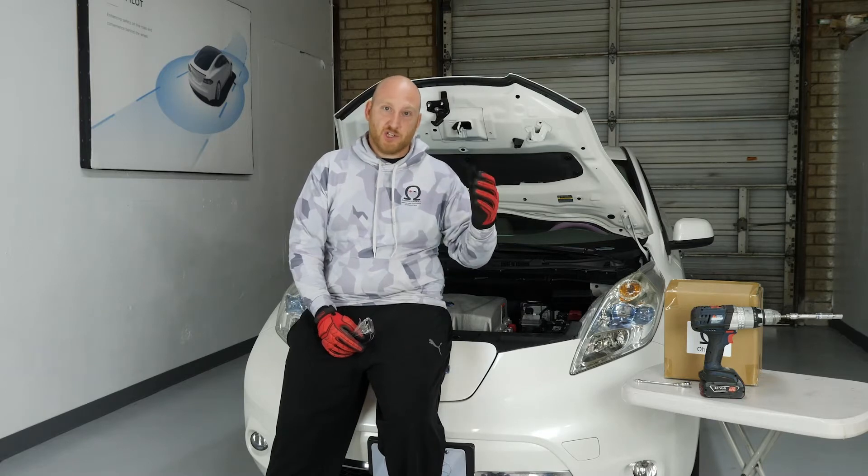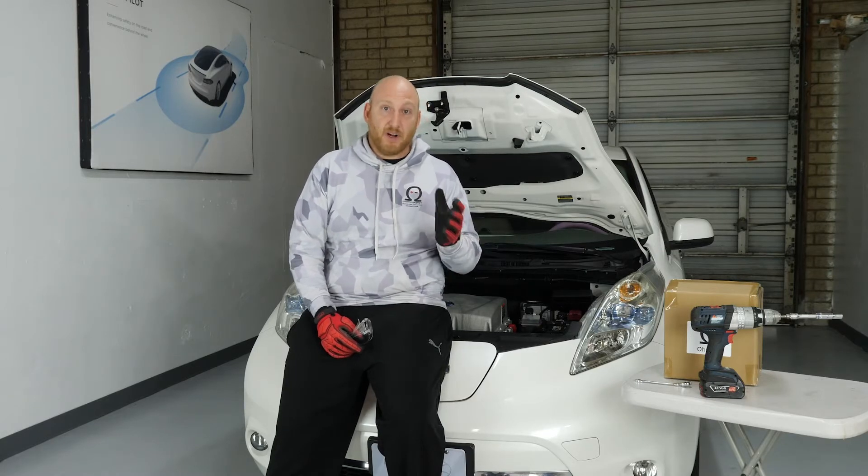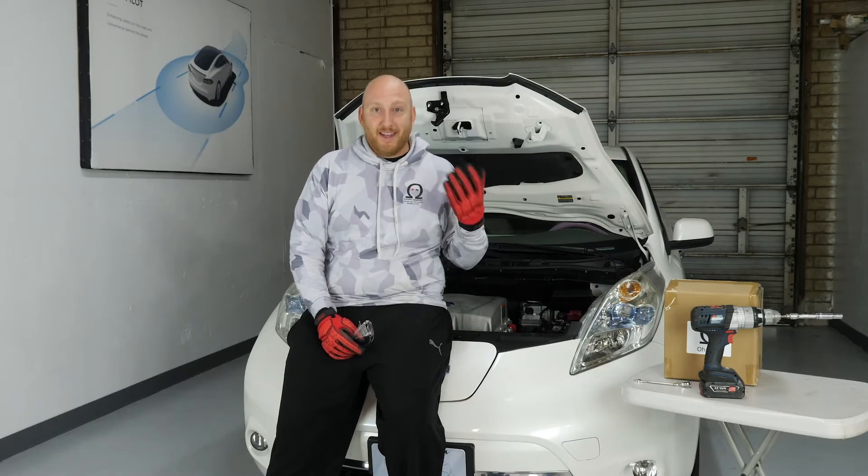Lithium is an awesome battery chemistry, especially for electric vehicles, because electric vehicles don't use their 12-volt batteries to start engines — they use the 12-volt battery to support electrical loads. So they discharge that battery and recharge it repeatedly. That type of cycling is wonderful for a lithium battery, which is why that's the battery of choice in cell phones and the big traction pack of electric cars. Besides the fact that they're much lighter, which is a huge benefit in an ultra-efficient car like a Nissan LEAF.